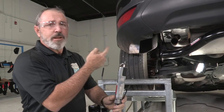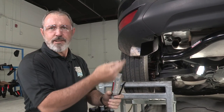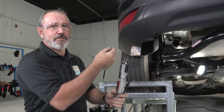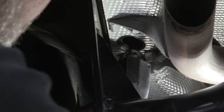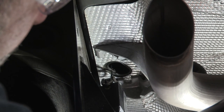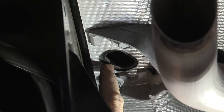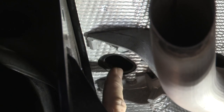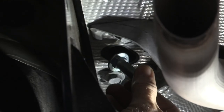To make a small notch in our access hole, I'm going to be using an air saw. If you don't have an air saw, a simple file or grinder can just take a little bit of that metal off. You can see we just took a little piece of this metal off here around the access hole, and that'll give us enough room to fit the hardware through. You can see that it slides right through now. We're going to go ahead and do the same exact thing on the passenger side.